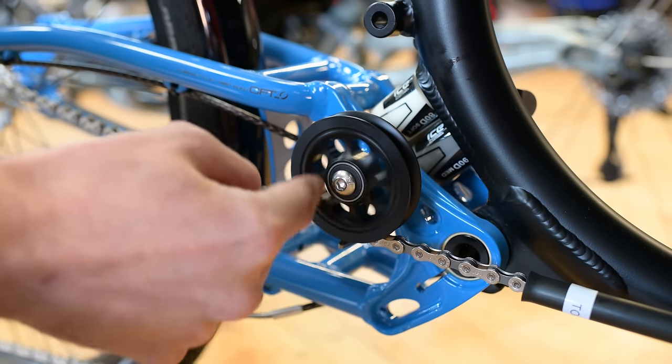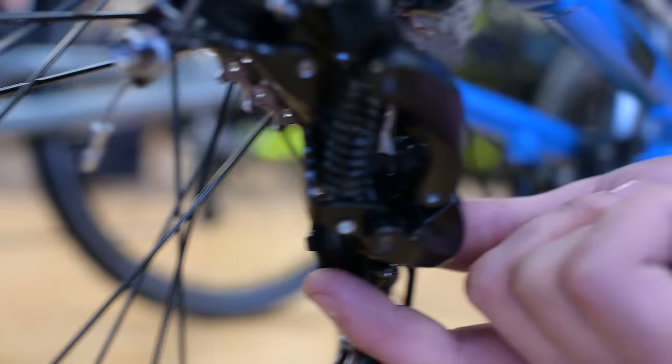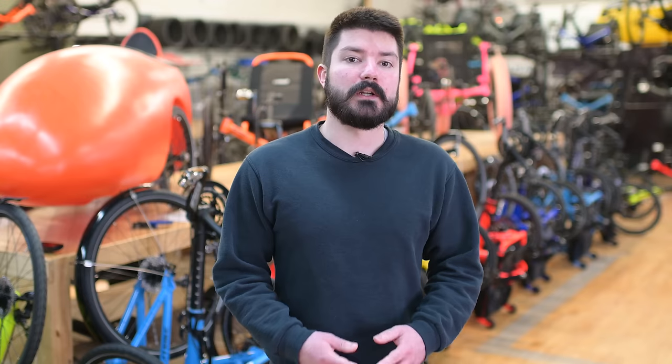Move back to the idler, then the rear derailleur, and your rear wheel. If you find anything amiss along the way, make sure to take the time to resolve those issues. Keeping the derailleurs adjusted and the chain clean will make shifting and pedaling easier. We recommend using a dry Teflon-based lubricant. Using a wet oil-based lube or something like WD-40 is not recommended, as a sticky wet chain will cause dirt to stick and add friction.